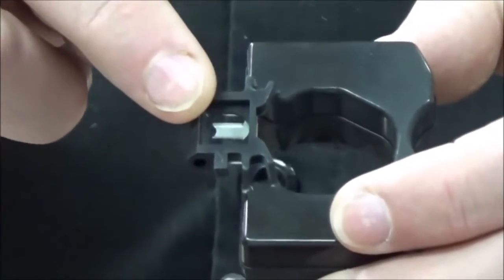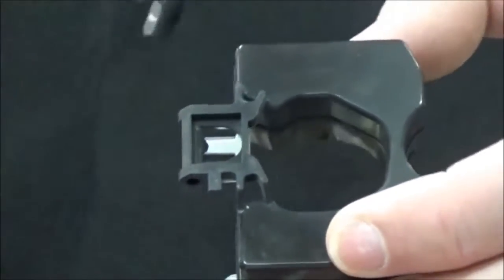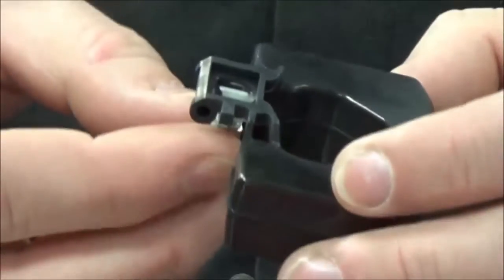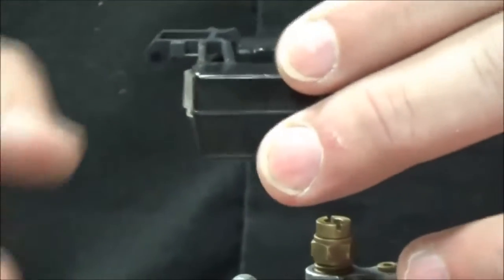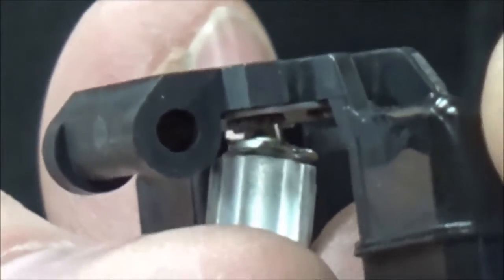You can see the metal tab in there. I'm going to adjust it and we'll make a video just on float height in a second. What happens is we take it and put this little clip around here so the float just sits on there. Watch this — do you see where it pushes in and out there?